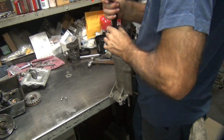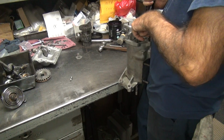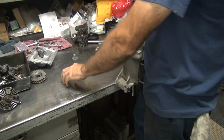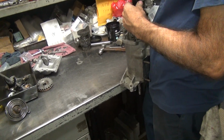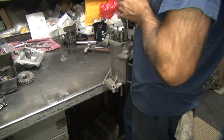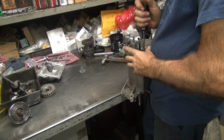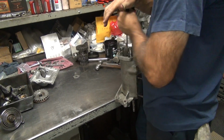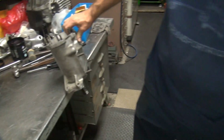This one's a little better. I think it's that bumper plate there, which is actually a drip rail. See how this one goes on easier? Until it gets down about halfway. Now, they don't use Loctite on these because they don't need them. The whole plate flexes, acts like a lock washer. See, they can't do a robot with this, that's why I don't use these screws anymore. You can't do this with a robot, so you can't have this type screw anymore.